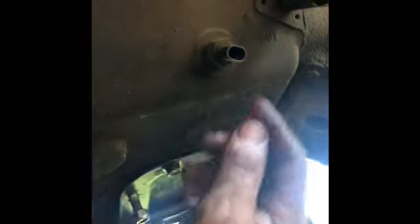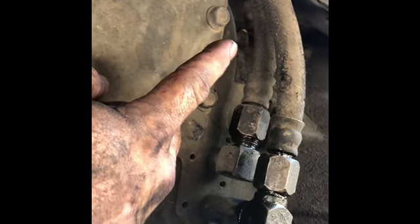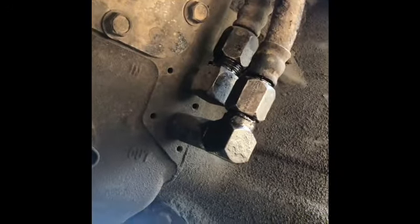Right here is where you adjust your clutch. I have a remote lube system — my grease zerks are out on the frame with a line that comes in here, so you have to take this cover off and take your grease line out. You have another one that goes to a little fitting right there — it goes up and makes a turn and comes back down, ties into that. That's for your cross shaft for your clutch. You also have one on the driver's side of the transmission. Take all three of those lines off. Don't worry about the coolant lines for your transmission.